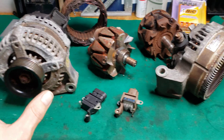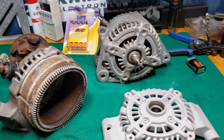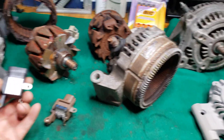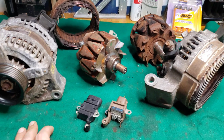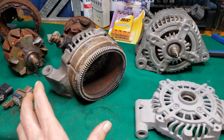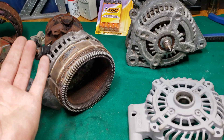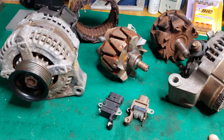This is basically just a breakdown to get you guys on the right path for searching what you can use. Look at any of the big alternator companies and you're going to see that they're using a Denso hairpin for pretty much everything, and a lot of them use GM plugs. It's not too hard to figure it out from there. I'll go into more depth in the next videos and show you exactly how to do some of those modifications, like the cheap stator modification — it's honestly just some silver solder, clippers, a little bit of time, maybe some heat shrink. It's not very hard. Thanks for watching and stay tuned for more videos.